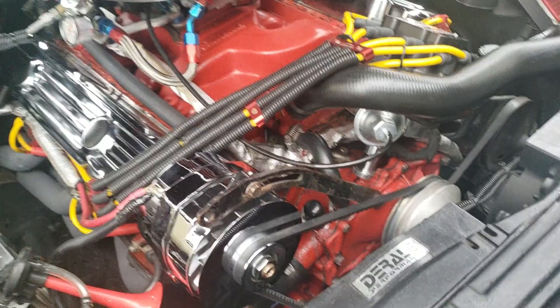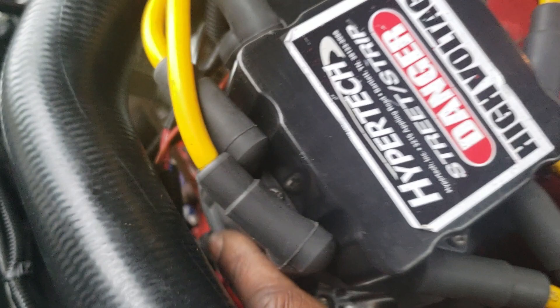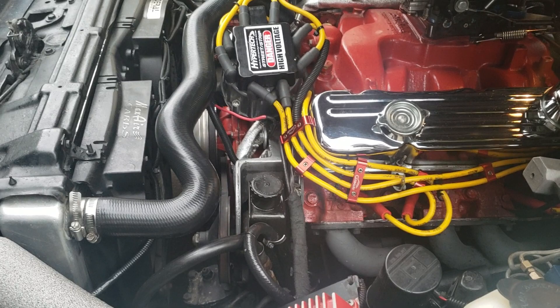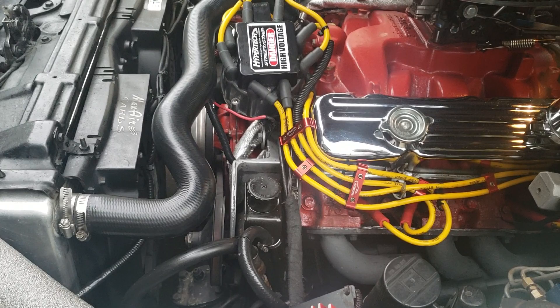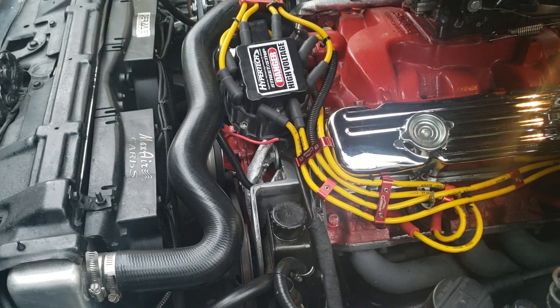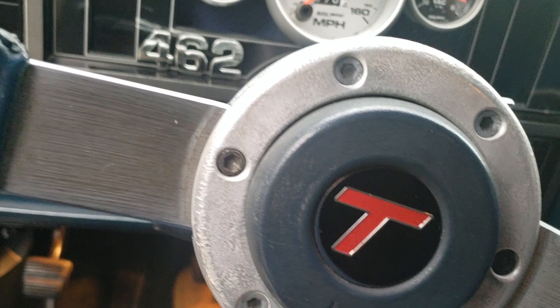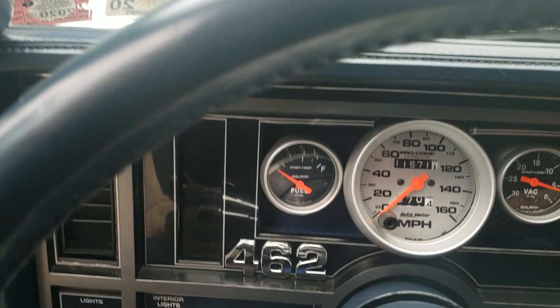All right, this video's purpose. Let me move forward, turn the power on. This is the ground to the distributor. I changed the power wire, and I think it's the tach wire — the negative wire. The tach wire connector had to be changed as well. The power wire was okay — that was my confusion. The orange power wire was okay, and that right there is the negative.